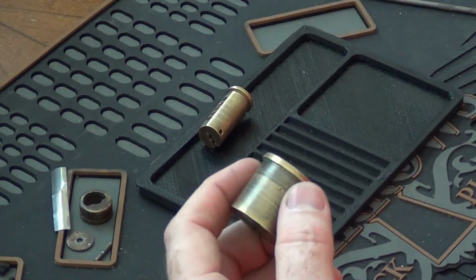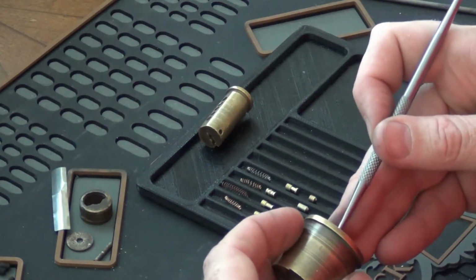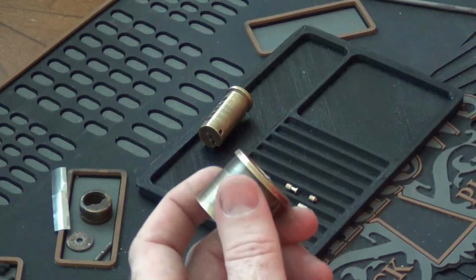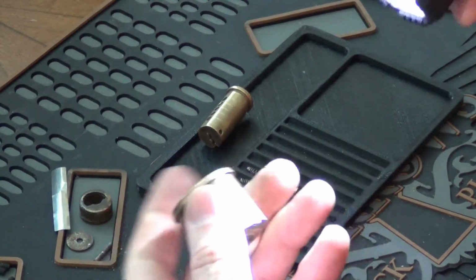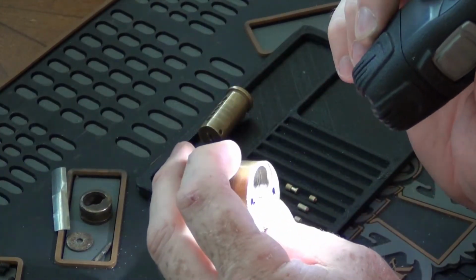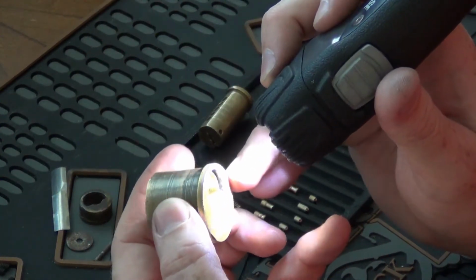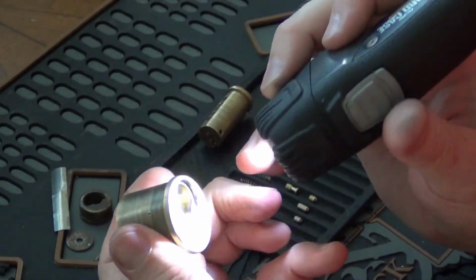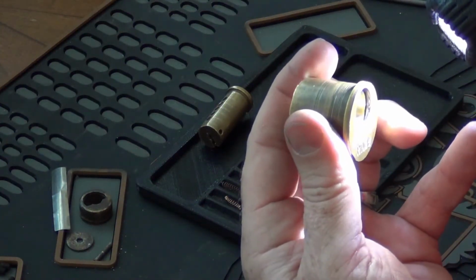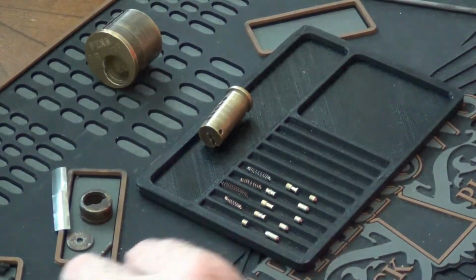Let's see, number 1. Number 1 is down in there. Number 1 does not want to come out, so he may be stuck. I don't want to pull him too hard. Let's see. He's got threading, and it looks like 4 and 2. I don't see anything in 1. Definite threading in 4 and 2 up top. The spring might have been caught when he slid this thing back on there. But it looks like a little copper spring in 1. I don't want to pull too hard and mess it up. So, alright, let's get you guys focused in so you can see the pins.